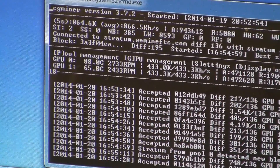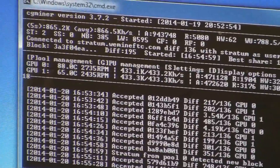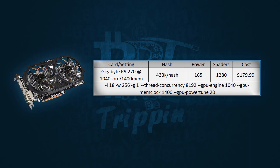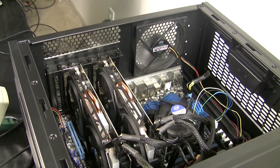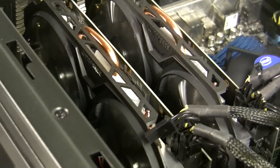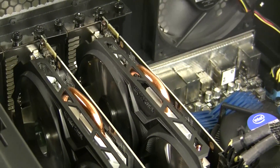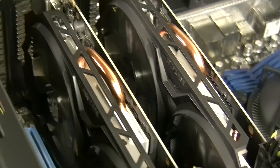With a couple of these sandwiched next to each other we were holding around 85 to 88 Celsius on one card and around 65 Celsius on the other. Looking at the table you can see the really good rate of return versus power usage. Cheap card, good hash rate — get a bunch of them. This is probably one of your best cost-to-hash-rate ratios right now, and it'll be featured in one of our upcoming budget build episodes.